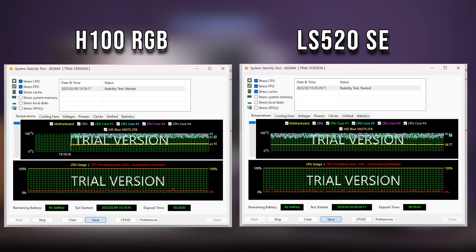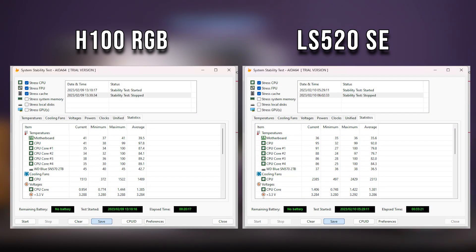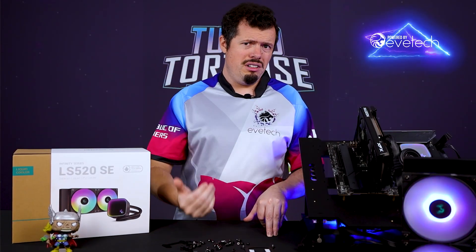The results came out with a good swing. Not only was it 10% less thermal throttling over a longer test period — I ran it 10 minutes longer than the Corsair because it was doing so well, trying to heat-soak it to see if it would continue dropping — but it didn't. It dropped less over time, with a considerably better average than the H100: 8 to 10 degrees better. On a scale of 100, that's 10% better, which lines up exactly with that thermal throttling result. In Cinebench across full 20-minute tests it didn't beat the Corsair H100, but it delivered better performance at a better temperature.